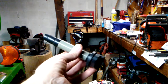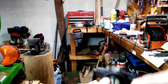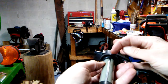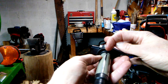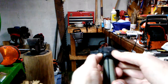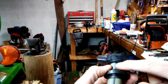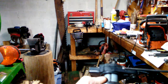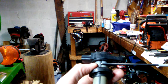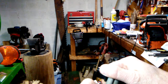First we're going to remove the old stuff off of our coil. There is a groove right here and the spark plug coil pack o-ring should have a groove in it, and you line those up. Right here you'll see a lip — a retainer spring, if you will — right there. That's got to line up with the groove in this piece. It helps to hold that boot in place. So we slip that off.